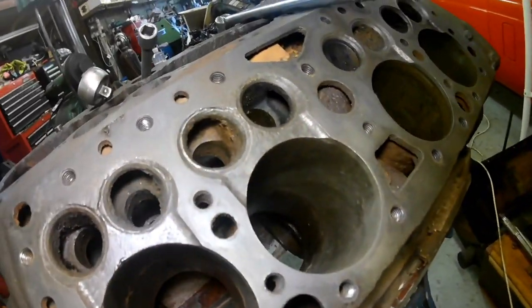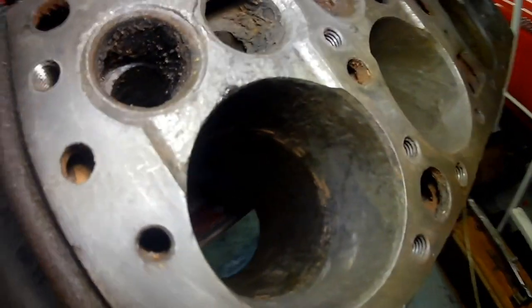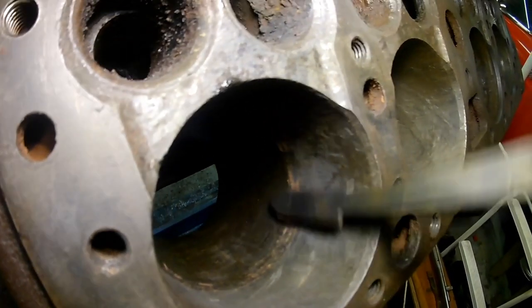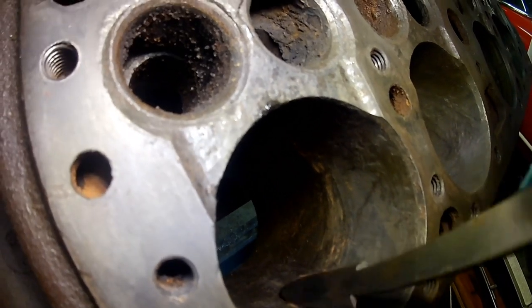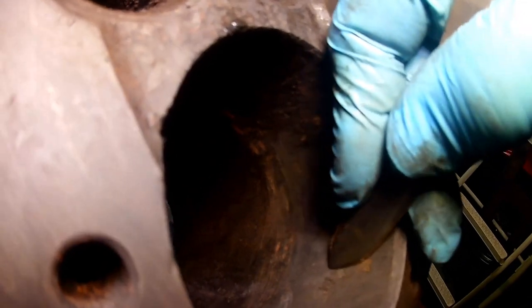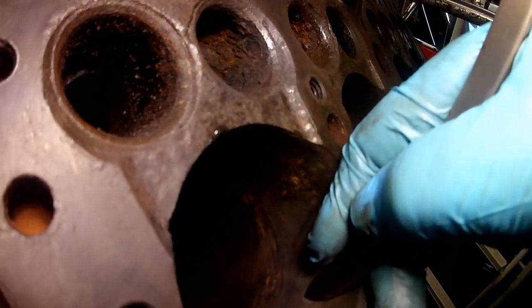I wanted to just show something that I've discussed on the forums but hadn't mentioned in my video with regards to this crusty flatty. If you look down in this bore, it's like you'd expect to see, isn't it? It's decent cast iron, just a tiny little bit of corrosion that easily scrapes off, and isn't a problem. But if you look higher up the bore in this area here, now I have had a good scrape at this. Can you see that? Look, it's just crumbling. There, can you see that crumbling? That's not good, is it?